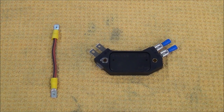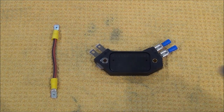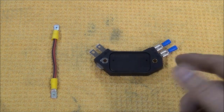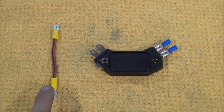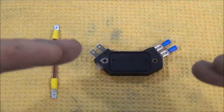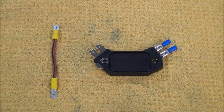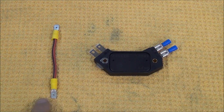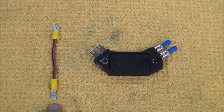If you don't have fancy connectors, you can use regular butt connectors — they do fit on there and work fine. You're also going to need jumper wires to jump over the ballast resistor. Once you unplug the cables from the ballast resistor, you need to connect them together to maintain the ignition feed from the key. If you have a single ballast resistor like me, you'll need one jumper. If you have a dual ballast resistor, you'll need to jumper both connections.